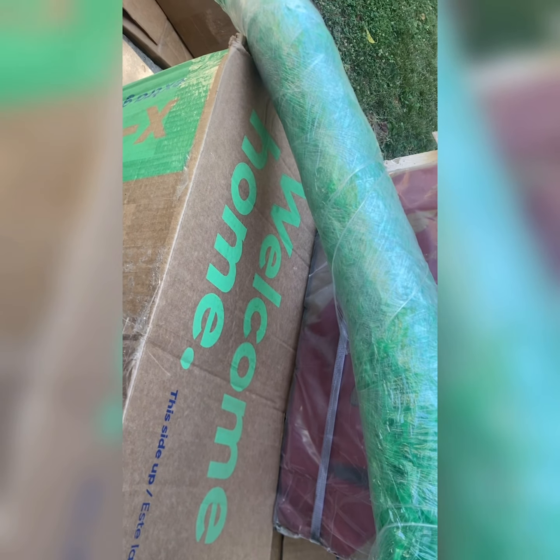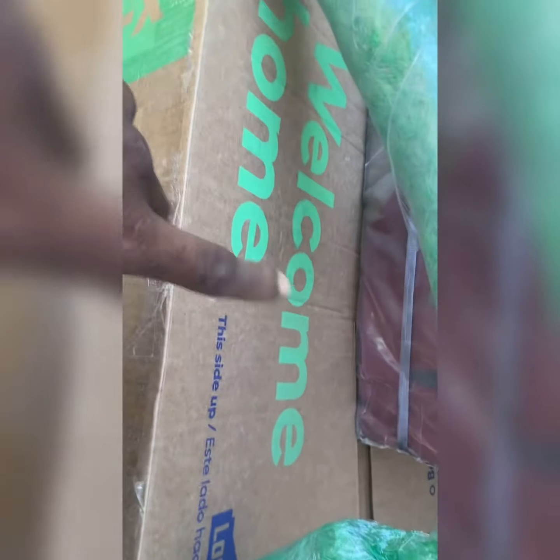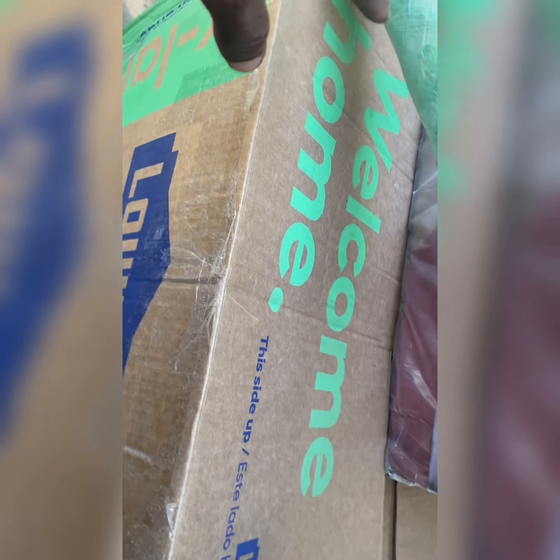So this is the intermediate pipe I was talking about. This will go from the left passenger side tire. The turbo is gonna sit right there where the airbox is. This will go all the way under to about the middle of the car where the long tube headers end. And remember I showed y'all there were three inlets on that pipe. Two go straight into the headers and then one connects in here with the turbo.